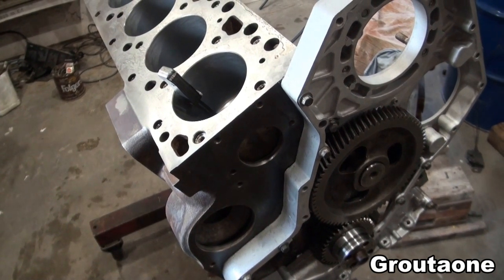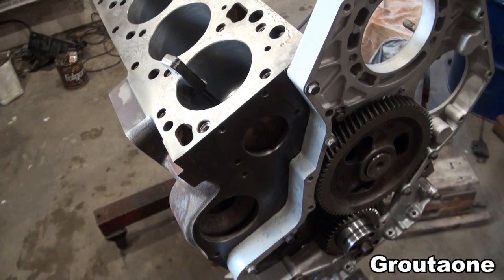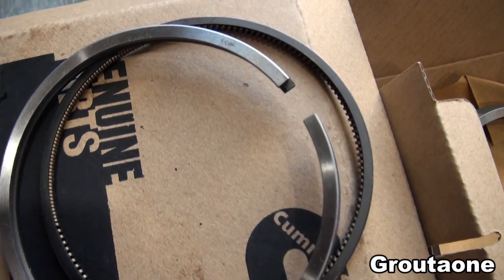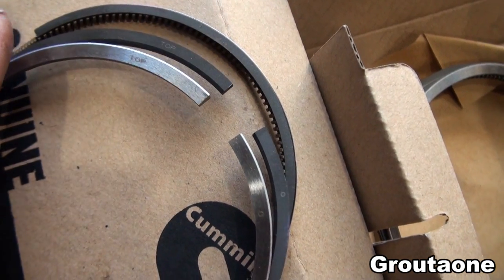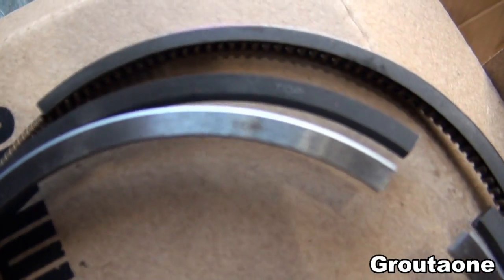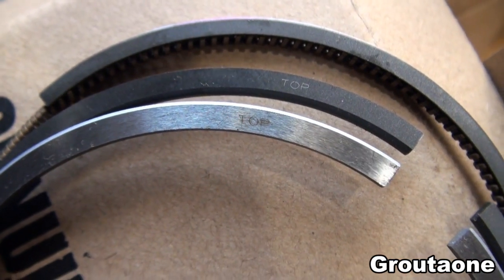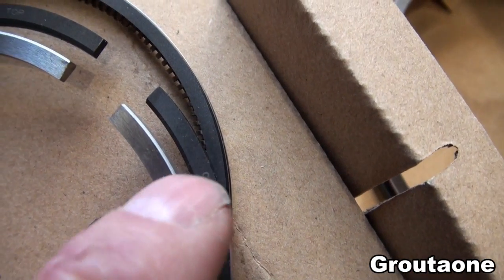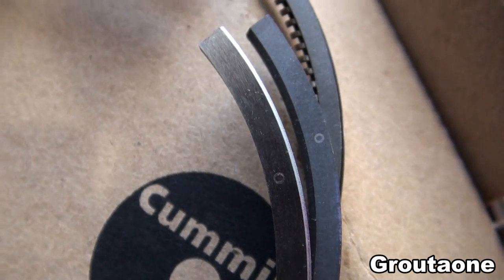This is a standard bore Dodge Cummins 12 valve, and I'm just getting started checking some piston ring end gaps. These rings are marked fairly nicely, but there's something I would think maybe they could do differently. Here's the top ring and the next one is the intermediate ring. Look how they have them marked — they're both marked 'top,' meaning up, so that's the upper part of the ring. They're also nicely marked with that dot, which is very typical for piston rings to indicate which way is up.